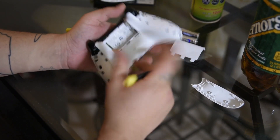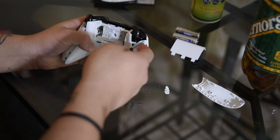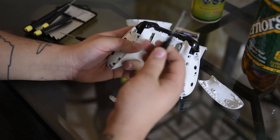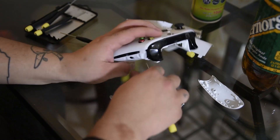This is the screw we need to get off to pull this top off. But let's just dive in a little deeper real quick. So using this screwdriver — or maybe a different one — see these screws right here. They are star bit. It looks like we're going to need a smaller flat head or the small screwdriver so this fits in here. Even though it's star bit, you can unscrew it. I can already feel the controller getting looser. Be sure to keep the screws in a safe place.